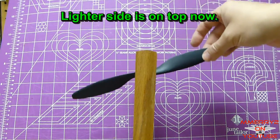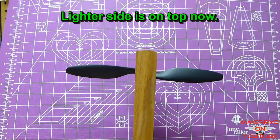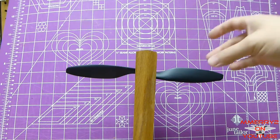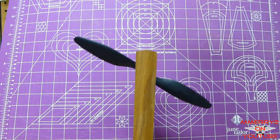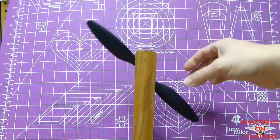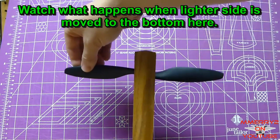How do you fix it? First, determine what side of the hub is heaviest. You do this by moving the prop around at different positions, letting go, and seeing which part falls to the bottom. The part on the bottom is too heavy. It's hard to understand, but imagine a large lead weight attached to the bottom.